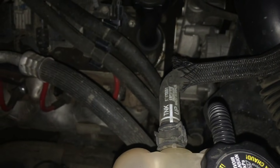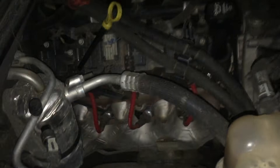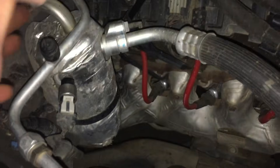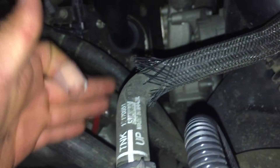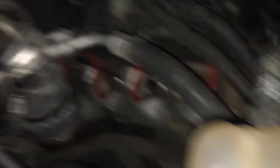A lot of people just go buy a whole new AC compressor and spend a lot of money for nothing — like I was. That's the weird thing: in order to add Freon, the clutch needs to be on, but if the compressor is low on Freon, it won't turn on. So how are you going to get Freon in there?